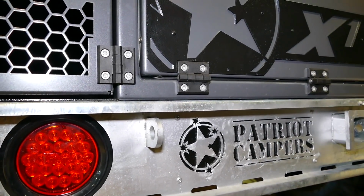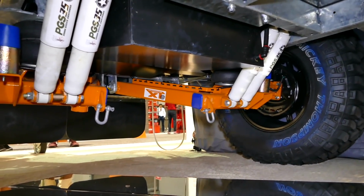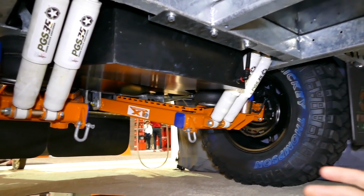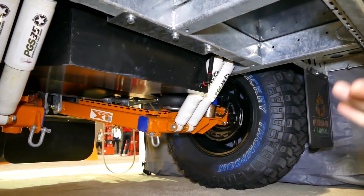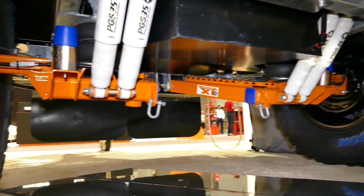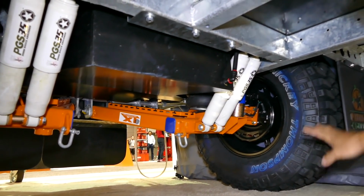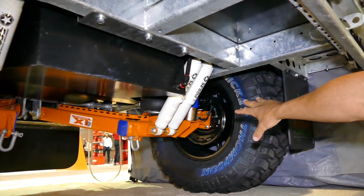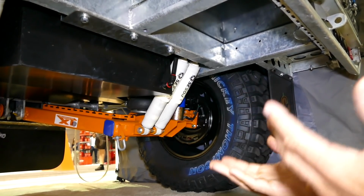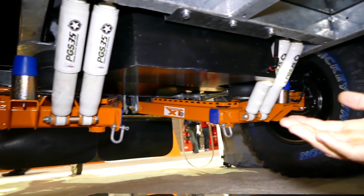While we're down here, if you get underneath the trailer, this is the best part. Fully independent dual shock suspension. You can see the airbags underneath there, they're a 4-ton Firestone bag. We have never in 4 years ever replaced an airbag. We've never sold one as a spare part. That's how tough they are. Nice. Got 10-inch electric brakes underneath as standard, and you can see the independent suspension. We've got dual tanks underneath here, so you've got a total of 40 gallons.